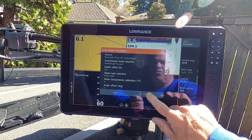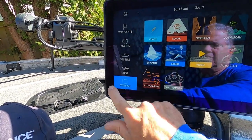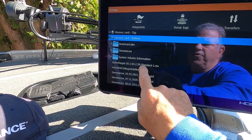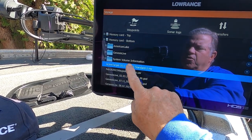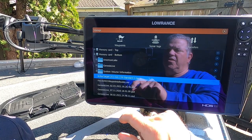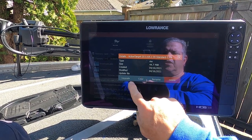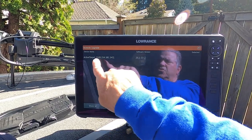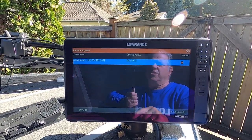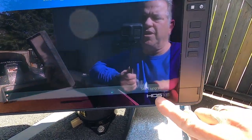We'll cancel out and go ahead and install the new version now. Press Pages, go back to Storage, go to Memory Card Bottom, select the .59 ActiveTarget software version and touch it. From this screen you want to press Upgrade. Press the ActiveTarget file on the card, it comes up, and we hit Upgrade. When you get to this screen, you'll see your ActiveTarget name. You have to touch it to highlight it — touch it, it puts a check mark in the box, and now it's ready to start the upgrade. In the bottom right corner, press the button that says Start Upgrade.